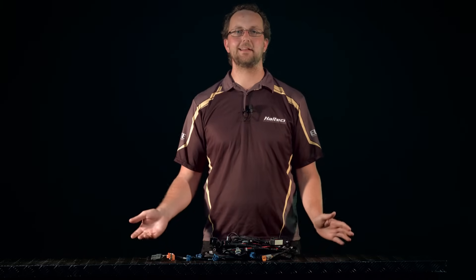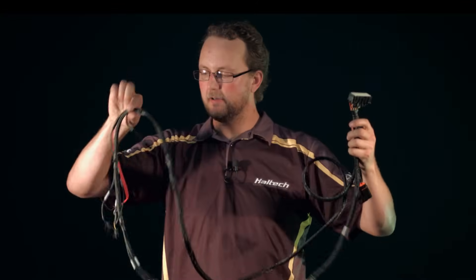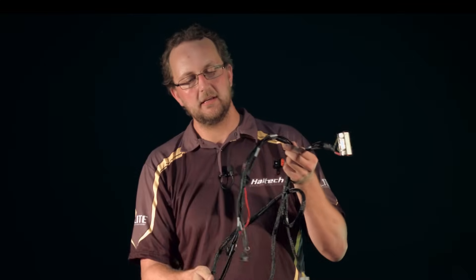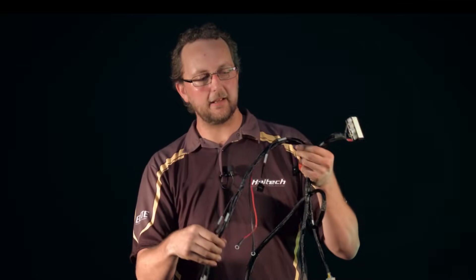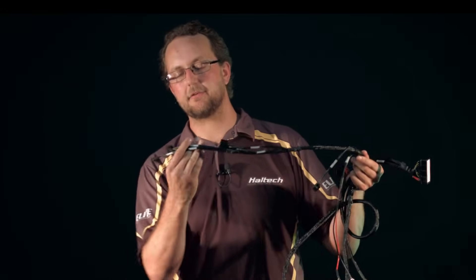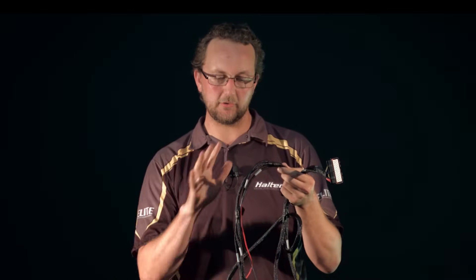Let's take a better look at the ignition harness in this 2JZ terminated harness kit. We've got two ends: one end terminates into either our capacitive discharge ignition system, our factory ignition module, or our HPI high power ignition system. It's then fused, and the wiring runs down to the other end, which is terminated with factory coil connectors as well as power and ground — everything terminated to length to suit the factory engine. The power and ground wires go straight to the back of the starter motor. Each plug is labeled: ignition six, five, four, three, two, and one — with one being furthest from the firewall at the front of the car. This makes it incredibly easy to plug everything in with no chance of confusion.